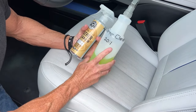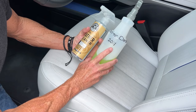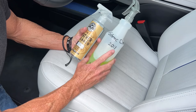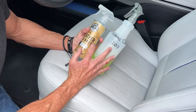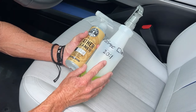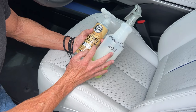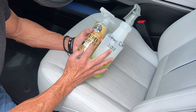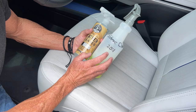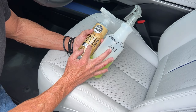I'm also going to bust out my fabric cleaner diluted down 20 to 1, which is the manufacturer's label instructions. If you want to keep your life super simple, you could use this and avoid having to buy a dedicated leather cleaner. If a fabric cleaner works on virtually any material inside the car including leather, that would prevent you from having to buy a second dedicated product — the simpler approach versus the more complicated approach.